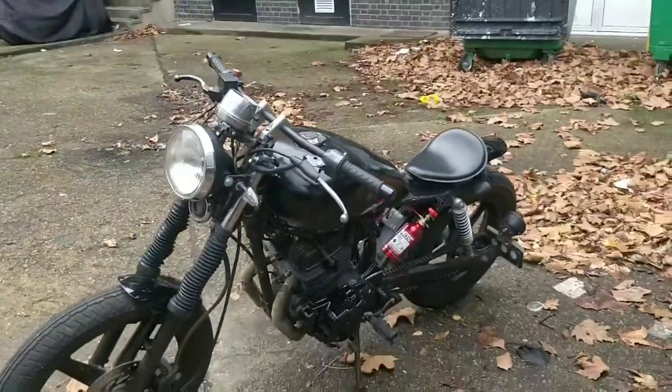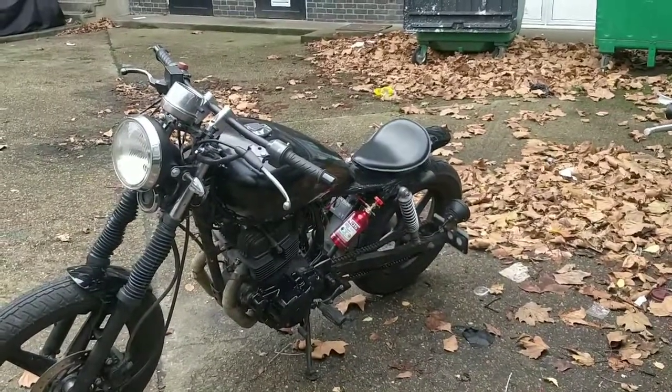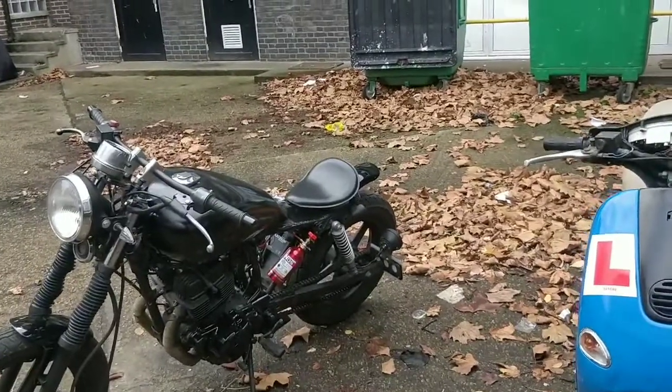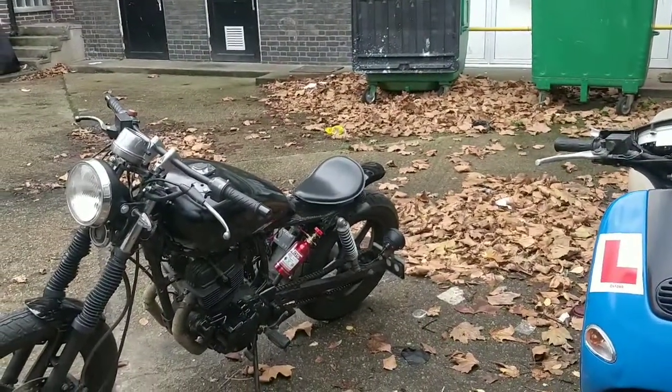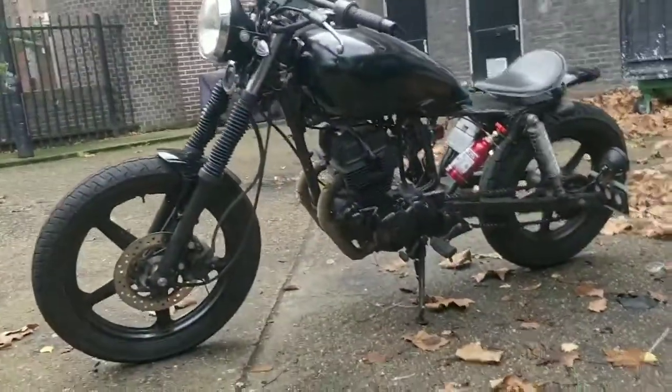It's playing up on Aiden, the XJ550. Last week it needed an oil gallery plug. I think I tightened the other one up too much, it had a split in it. But it has a rev problem, he says, and it kind of lifts its revs up and down, and it's intermittent. I haven't seen it yet. I've been to the bike 3 times and haven't seen it. But last time it was particularly bad and the bike cut out.